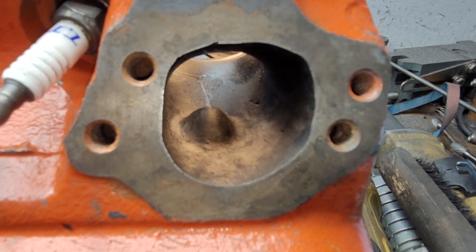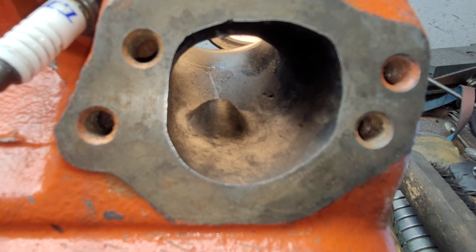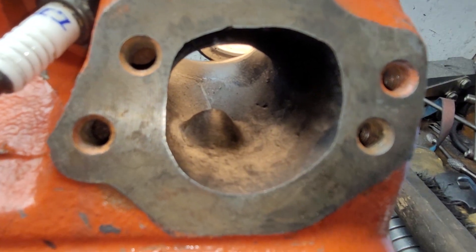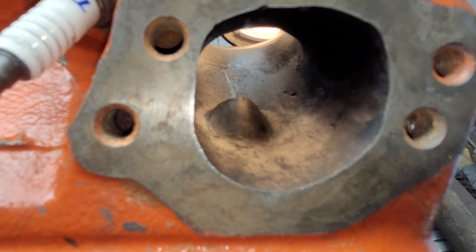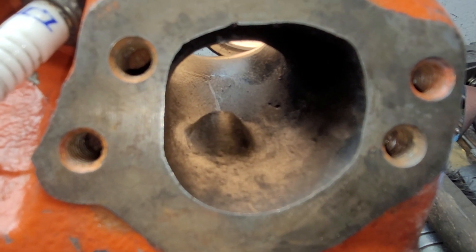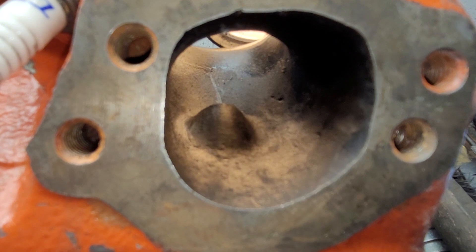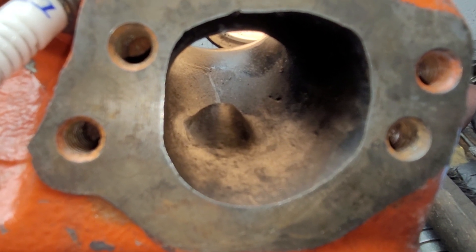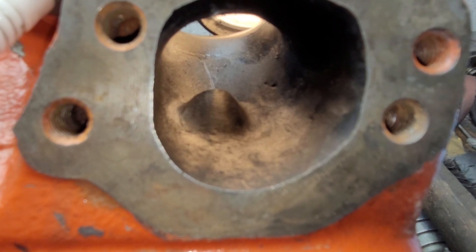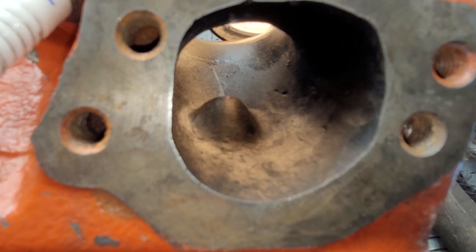You can see they changed the shape of the exhaust quite a bit, and judging from the air speeds he did get some improvement out of it, but it's a little big for the air it's passing. It's a lot better than the stock W2 which was in a 769 casting, but this has a much bigger throat cut into it - I think it's a 90 throat on the exhaust and the intake is a 91 throat. The chamber size is about the same as a regular LA, around 71 to 72cc. The other 769 head has a much tighter chamber - I think it's 56cc.